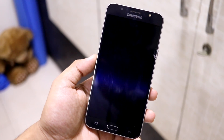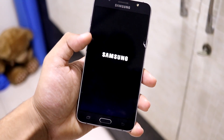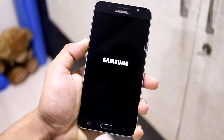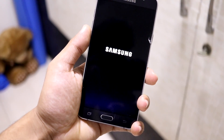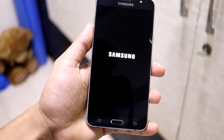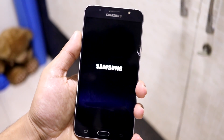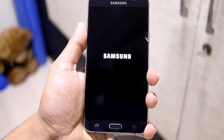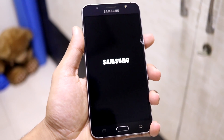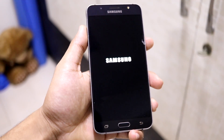The device will boot in a minute or two — just wait. It will show the Samsung boot animation. People might feel like it's boot-looping or stuck, but don't worry — just wait and it will boot fine. After the first boot it will lag a little bit. To fix the lag, go back to recovery and wipe the Dalvik cache and cache, and it should be fine afterwards. After every boot it lags for about 10 to 20 seconds — just keep your device idle for that time and then you can use it fine.